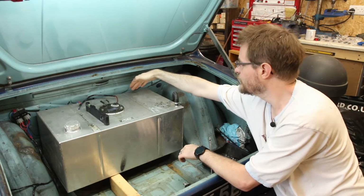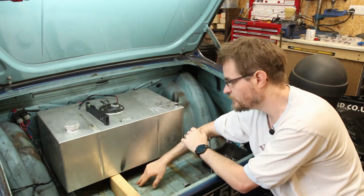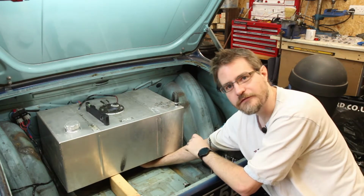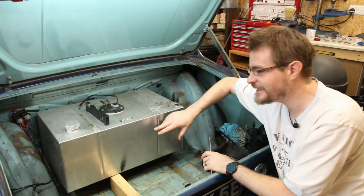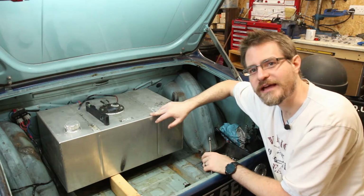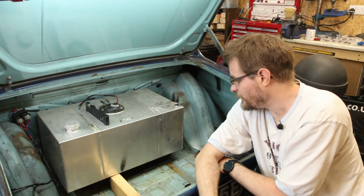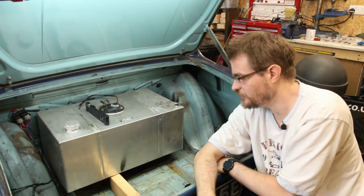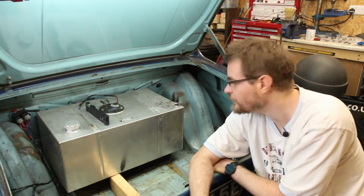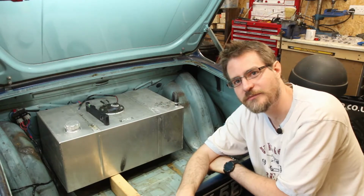come from across the bottom, down, and then a little lip so that I can probably bolt it to the floor, because as I said, I want to be able to get to the diff carrier bolts just in case, although I might drill a hole in it. Decide when I get there whether I want to bolt it down or whether I want to weld it in. Obviously welding it in will be a lot stronger and will also help tie the back of the car together a bit better, or even stronger, so I might even weld it. So need to measure this and then get cutting and folding up some metal.